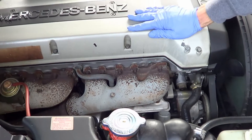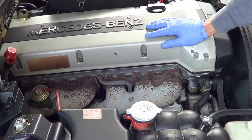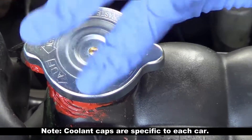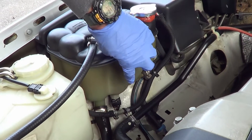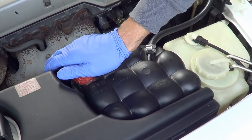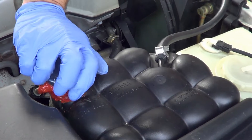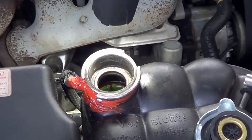If it's warm, don't do it because it's not safe. This car hasn't run for over 12 hours, so I know it's safe. I'll still be wearing protective eyewear as the system always has some pressure in it. The coolant level for the R129 should be here, but because of the discoloration of the reservoir it's hard to tell, so let's open it. Press down and spin — you can hear some pressure letting out. So it needs to be at that line in there, and mine is.